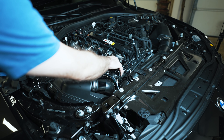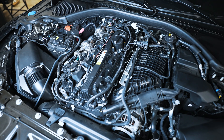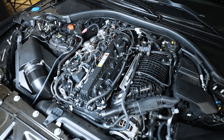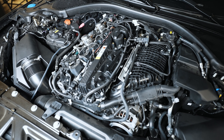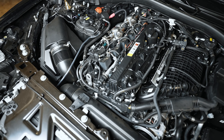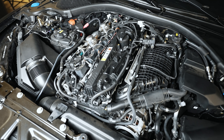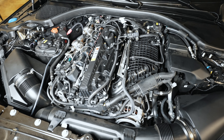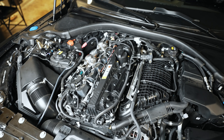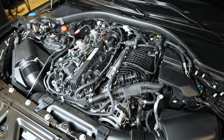If you were to unplug the cam sensors it probably wouldn't stall the engine — it would just run differently, because it can always use the crankshaft to at least keep things going. From my perspective, is this engine super complicated compared to how things used to be? Sure. But compared to regular turbocharged inline sixes — not really. You have Valvetronic, dual fuel pumps which is kind of unique, and electronic wastegates. It's a very efficient engine in terms of making power on 93 octane — makes a lot of power without needing ethanol. It's not super complicated; the connectors don't overwhelm me — it's actually pretty simple.